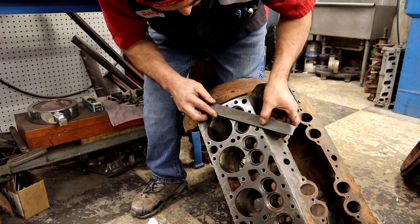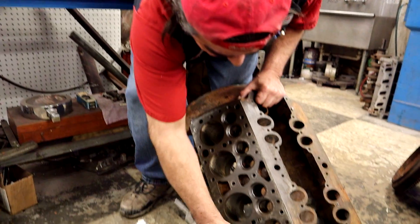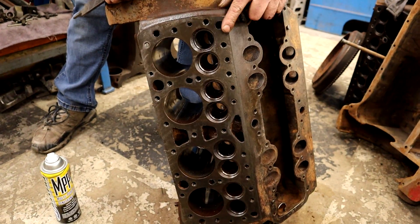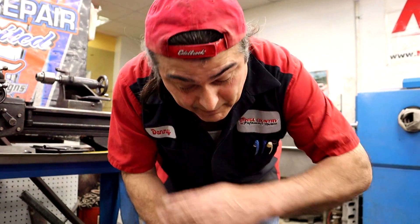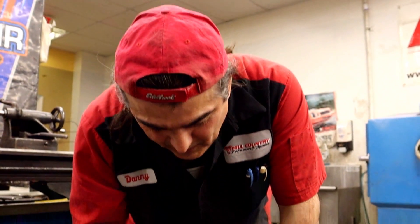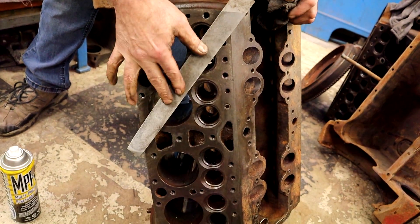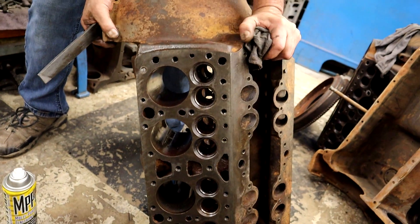This is actually a 1948 engine. And you can see in 1948, the deck is actually really nice. We're removing all the crud. So you can imagine your Toyota — you're going to take this and do that and it'll be perfect. I'm so glad I haven't touched it yet. That's why you don't want to use a scotch brite — everybody uses it, it makes it shiny. We don't want it shiny, we want it flat. And by going at a 45 degree angle and a 45 degree angle, we're not really working any one spot. But that's just an example of what we do.